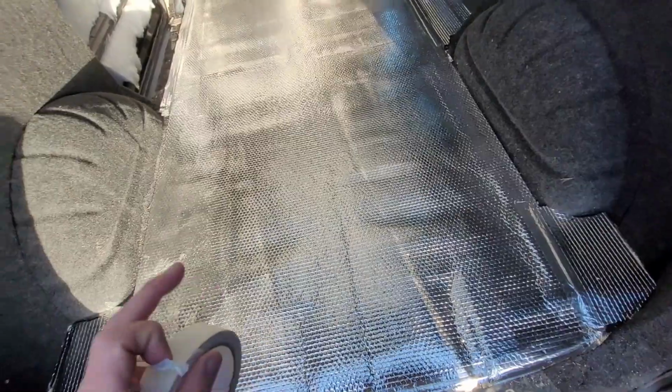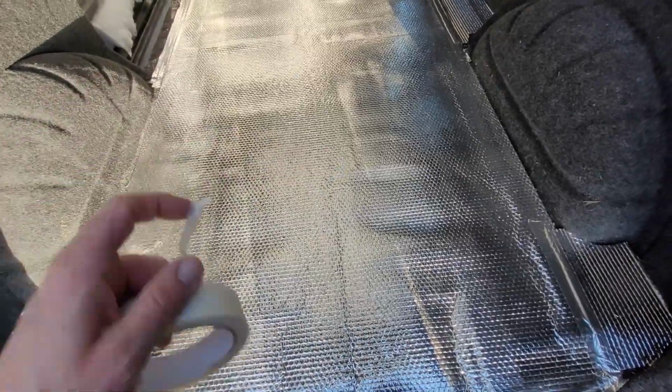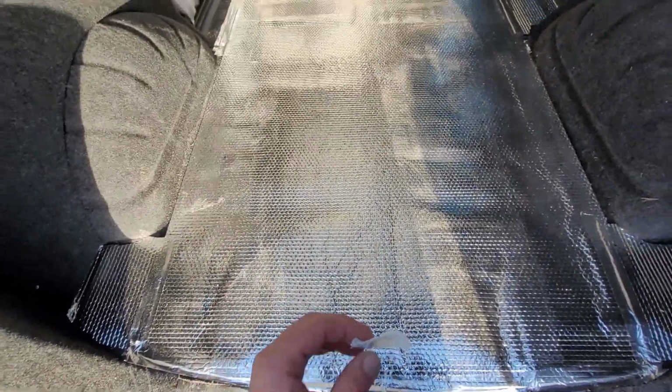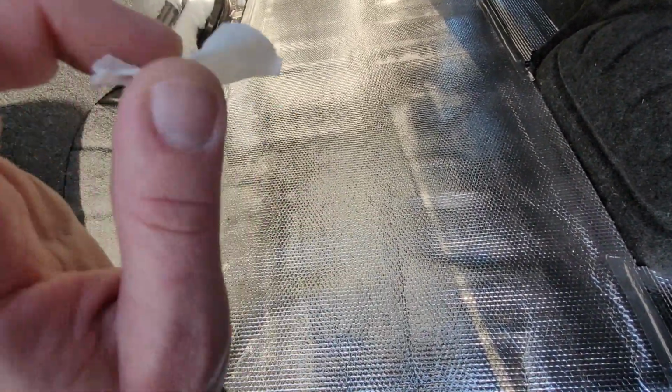Okay, now of course I don't know where my battens are for when I want to screw down my new floor into those battens we put in. So what I will be doing is adding bits of tape as reference. I've also got pictures as well, so I know there's a rib across here, a couple down there, one either side of this, up down these arches, in the corners. You know, I'm not trying to put the floor down so it will never come up again. I'm not trying to put 100 screws in it. I'm trying to keep the floor as level as possible and the join between the two pieces as level as possible, because the flooring that goes in will show everything and anything.